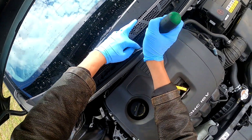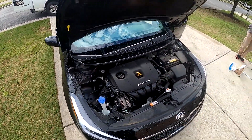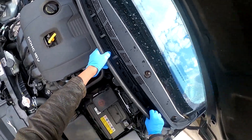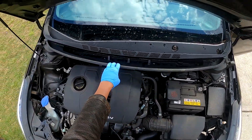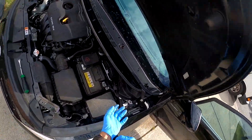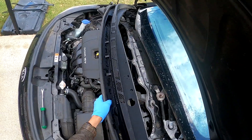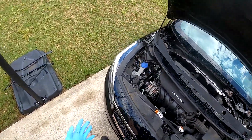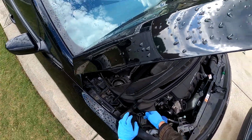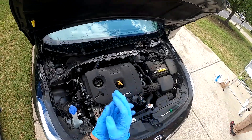Make sure you look for every single clip or you will end up breaking them — you want to save as many clips as you possibly can, because if not it can cause vibration and noise you don't want to deal with later. Once all those clips are removed, pull the cowl off as carefully as you can. Keep in mind the brake reservoir is kind of in the way, so leverage from one side to the other. Also disconnect the washer fluid so you can go ahead and partially close the hood — just enough to cut the glass without too many problems. Place the cowl somewhere safe.